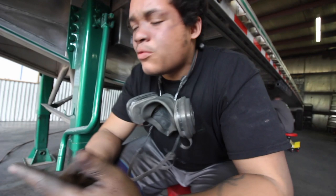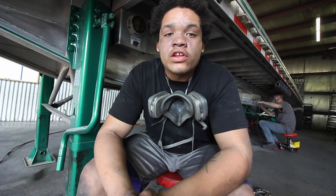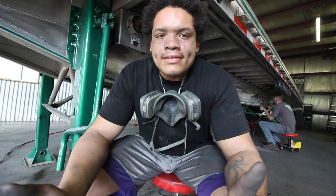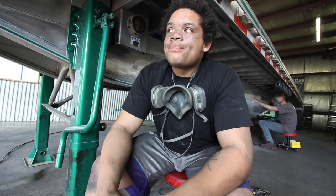So like I said, what I'm gonna do is go side to side first, and then I'm gonna work up and down. Now what I wanna tell you guys is you always want to finish up and down. The reason is that if you finish side to side, you might see your sanding marks. If you finish up and down, you're not gonna see them as well, because there's a theory behind it. I just forgot what the theory is. So let me show you guys what I do.